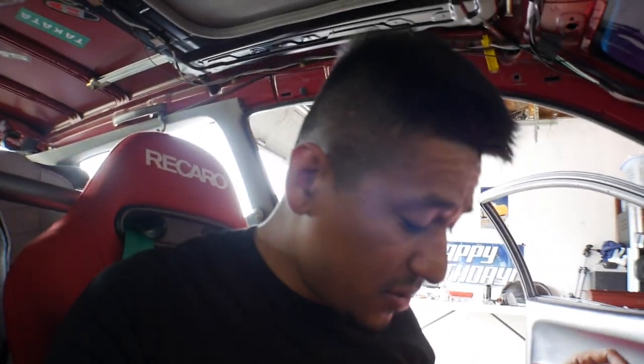We're gonna do our power right now. We're gonna run our constant 12 volt power, and that's gonna be ran down to our foot, or I don't know what it's called, our foot well, I think that's what it's called. And then it's gonna be triggered by the ground there. Once it's grounded, it'll turn on the LED. We're back, guys. Battery ran out, and we're gonna run that to the foot well, like I said. Once we're done with that, we could mount our LED strips, and we'll be done with the install, guys.